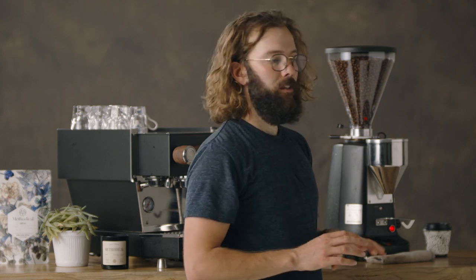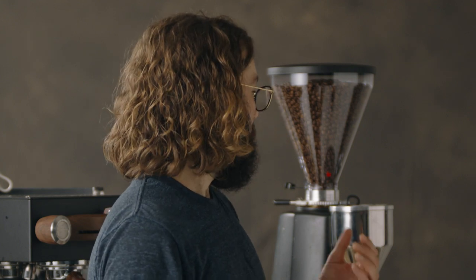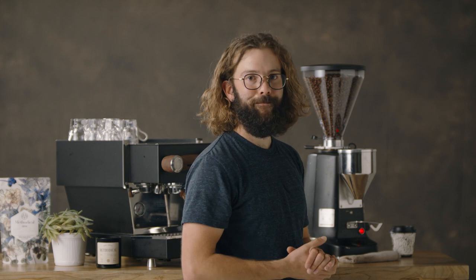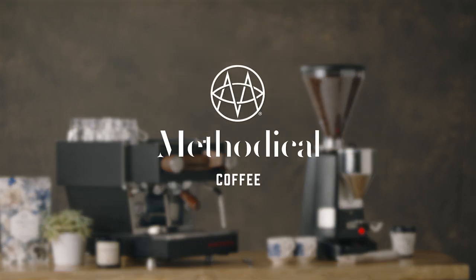Essentially, that is the light cleaning of your espresso grinder. There's a lot more detail-oriented technical situations you might get into, but at the end of the day, if you are taking your coffee beans out of the hopper, purging that out, vacuuming, making sure there's not tons of coffee dust inside your coffee grinder, and every once in a while grinding those cleaning tablets through to really purge out and clean the burrs, then you're going to be in pretty good shape. I'll see you in the next one. Bye.